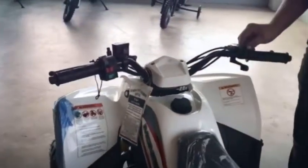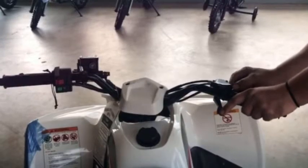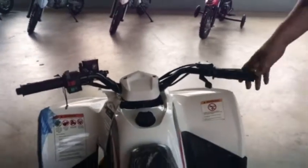Throttle is right here and you have a throttle control screw right here as well. You break that nut loose and back the screw out, you have more play with the throttle. You run it in and it blocks the throttle so you can set the speed accordingly.